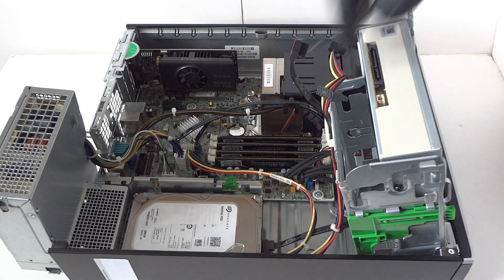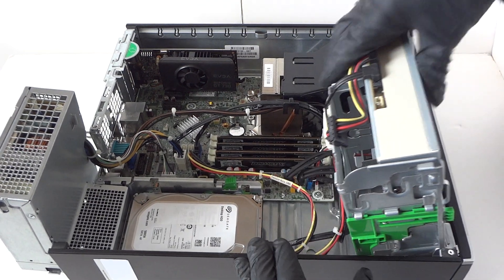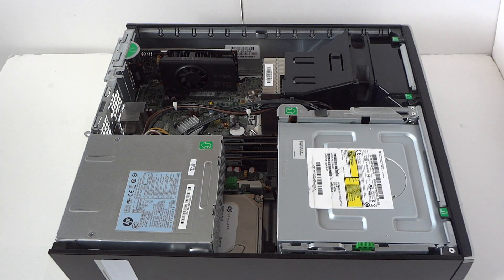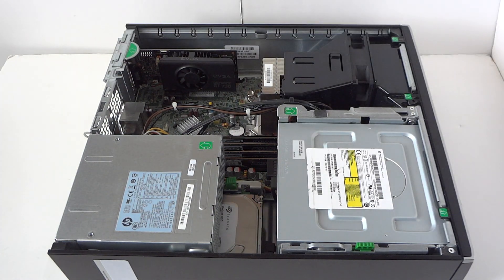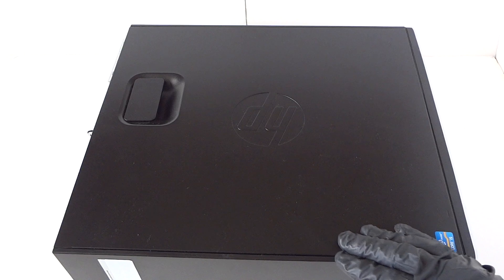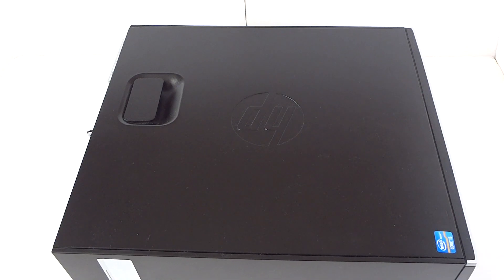Connect back the SATA and power cable. I'll do a separate video for the processor upgrade and a full disassembly teardown. When you connect the monitor to the video card, go to nvidia.com to download and install the drivers. Start the computer and get that done. Let me put the side cover panel back. That's it for this video on the HP Compaq Pro 6300 small form factor — thanks for watching!